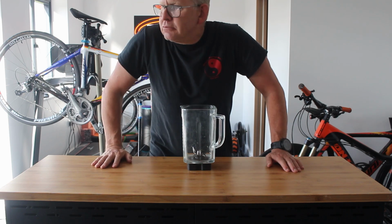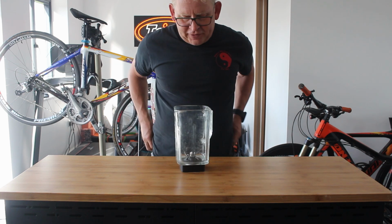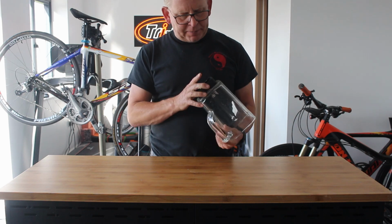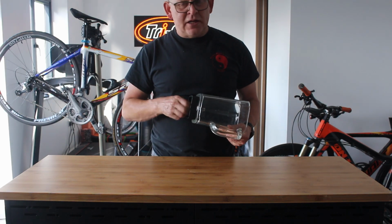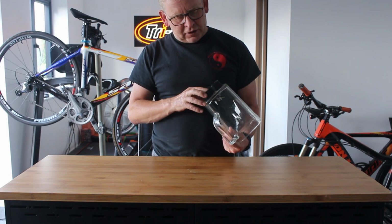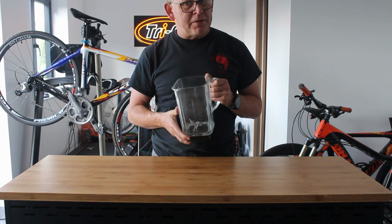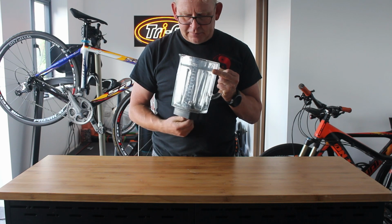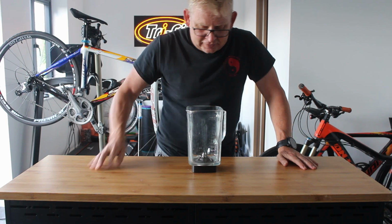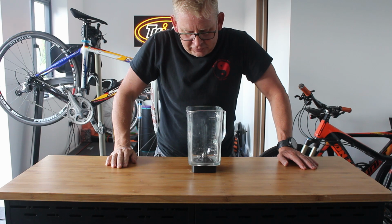We had a washing machine that's just blown up that I swore blind we'd had less than 3 years, and it turns out we've had it 10 years, but the bearing's gone in that, can't repair that, otherwise you would have seen it. Well, I could repair it, but the way Beko make them is the casing that the drum sits in that holds the bearings is plastic welded together, and the only way you can get to the bearings is to break the plastic weld, and then you've got to re-weld it back together, and there's no other clips or anything, so no chance of it being waterproof afterwards. So it's a really poor design by a company that needs to give their heads a wobble, because the bearings are the weak spot anyway. So the washing machine would have lasted quite a long time, and it should have been fixable.